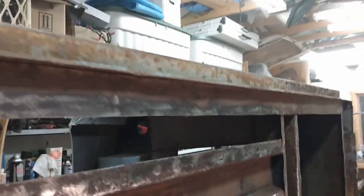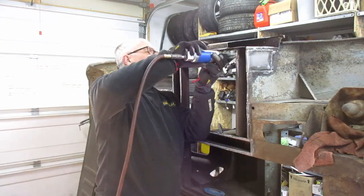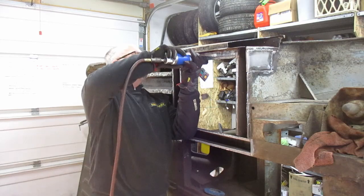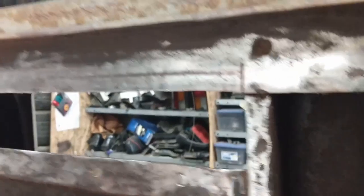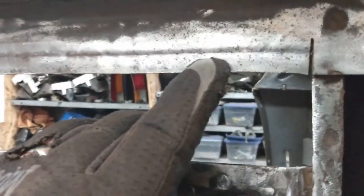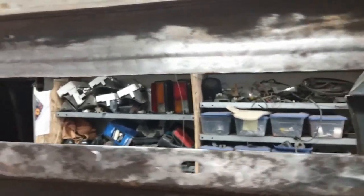I have this piece across the top all trimmed off now, and as you can see it's a lot straighter. I'll give it a clean up first with the flap disc. I've got a couple of slots cut in here. So the next step, now that this is all cleaned up, is I'm going to take the flange tool and go all the way along there. Now we have a nice flange all the way along the edge here. I'll just adjust the floor pan to notch down under here and just butt weld this part here. The idea is the floor pan will come up to this line here or just short of it, so it sits flush on the underside, and I'll stitch weld that all the way down there.